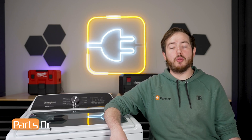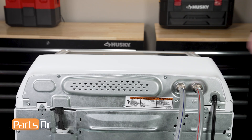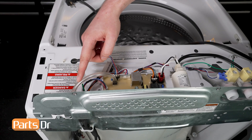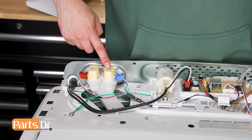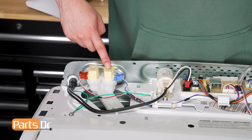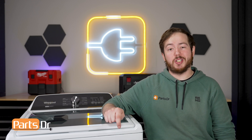There are four components to the washer's water inlet system. The hoses on the back of the washer deliver hot and cold water from the house to the washer. The pressure hose sends a signal to the pressure sensor on the main control board to detect the amount of water in the tub. The main control board regulates the power sent to the water valve, and the water valve fills the washer with the proper amount of water for the cycle. We won't cover the full repair instructions for each of the parts in today's video, but we will have those listed down in the description below.